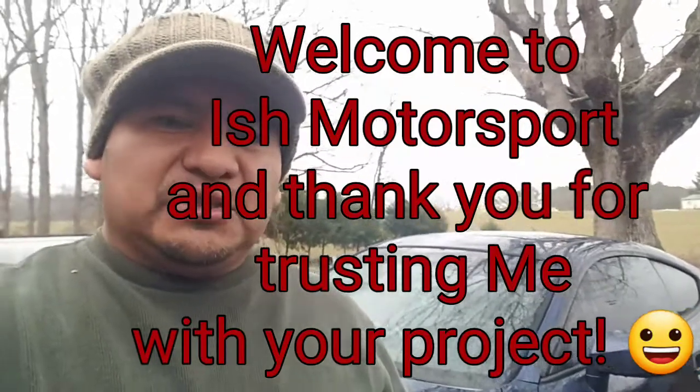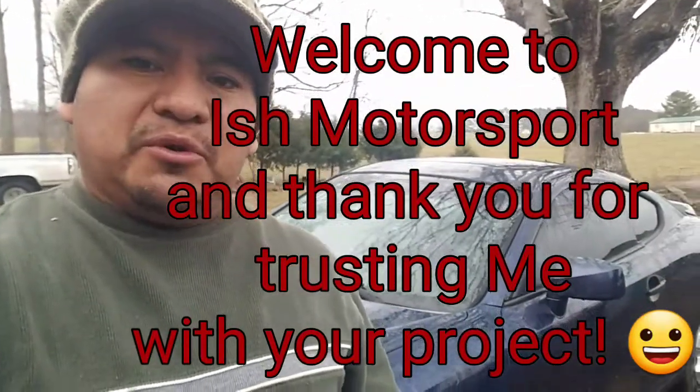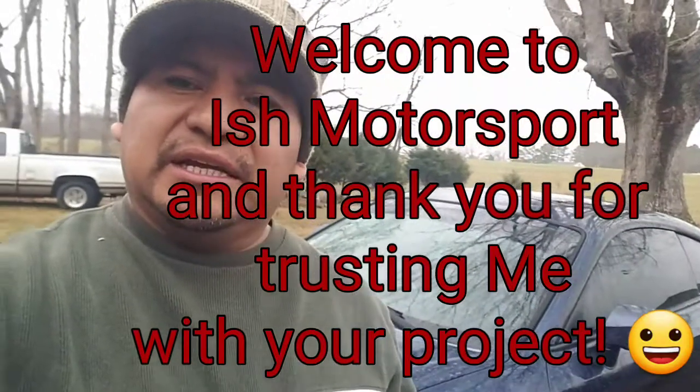It is cold this morning, so today I'm going to be working on the 2006 Hyundai Tiburon. The problem on this one today is that the heater and the AC will not blow any hot or cold air. I believe it is the blower motor or the resistor or the relay, one of those, because it will work sometimes and sometimes it will not work. Let's just say it worked yesterday and today it will not work, and tomorrow it will work again.